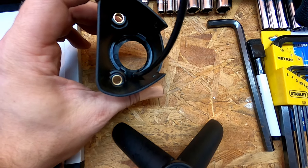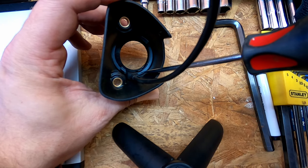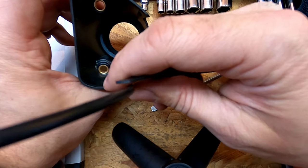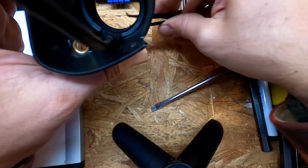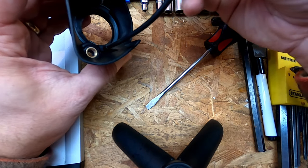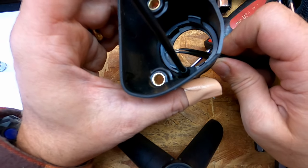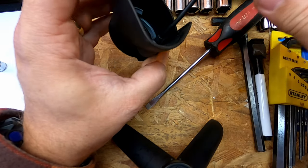The first one, I weaseled a screwdriver in and just turned it a little bit to push that back. And since the plug is actually part of this, this cable doesn't disconnect from this, I was able to pull just slightly as I went and get it up through there. And then what I did is I took this pair of really sharp, kind of bent angled tweezers and stuck them into the gap underneath and kind of worked my way around underneath. And then up from the bottom here, I was able to basically just push as I went around